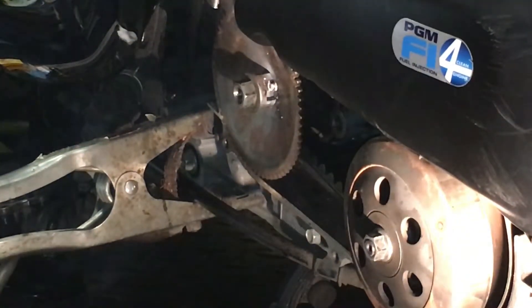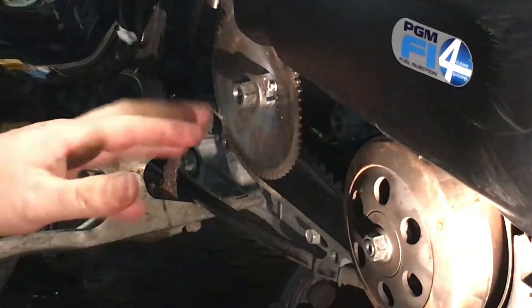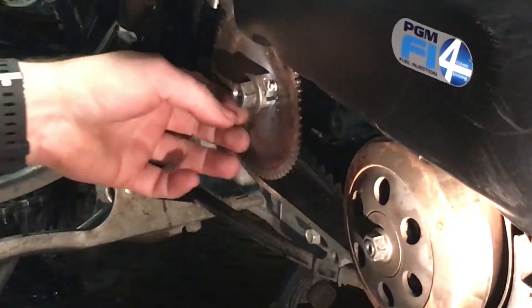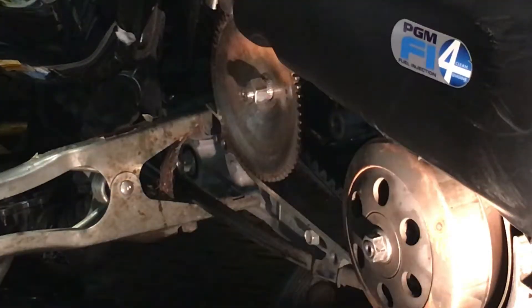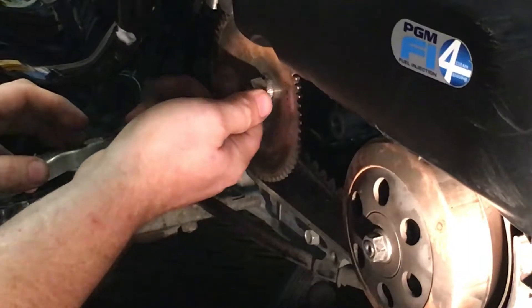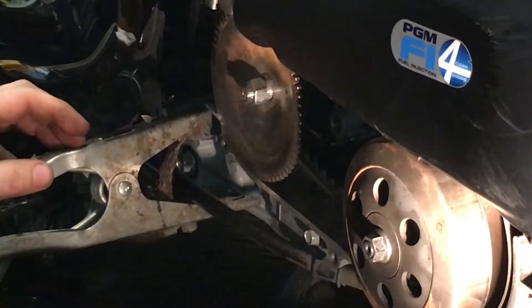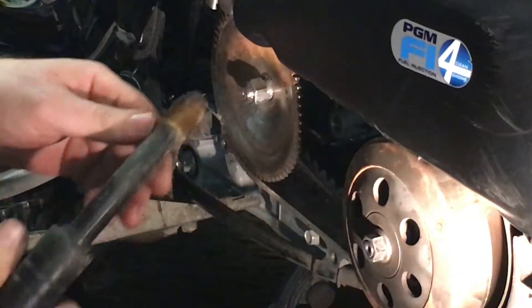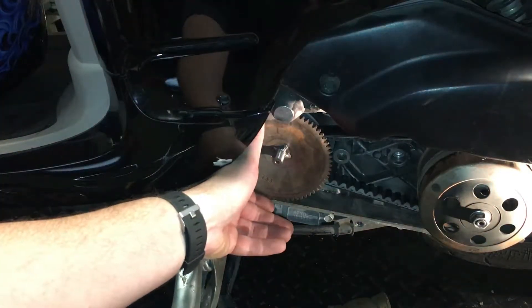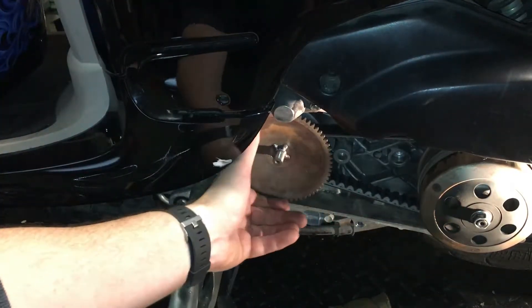Make sure this doesn't wiggle — there's rubber here. We're going to let that completely cool. It turns out that tack weld was pretty good; it's not wiggling. I just put the nut on to protect the threads from splatter, going 180 degrees. Here's the final result — we've just got four tack welds around there.